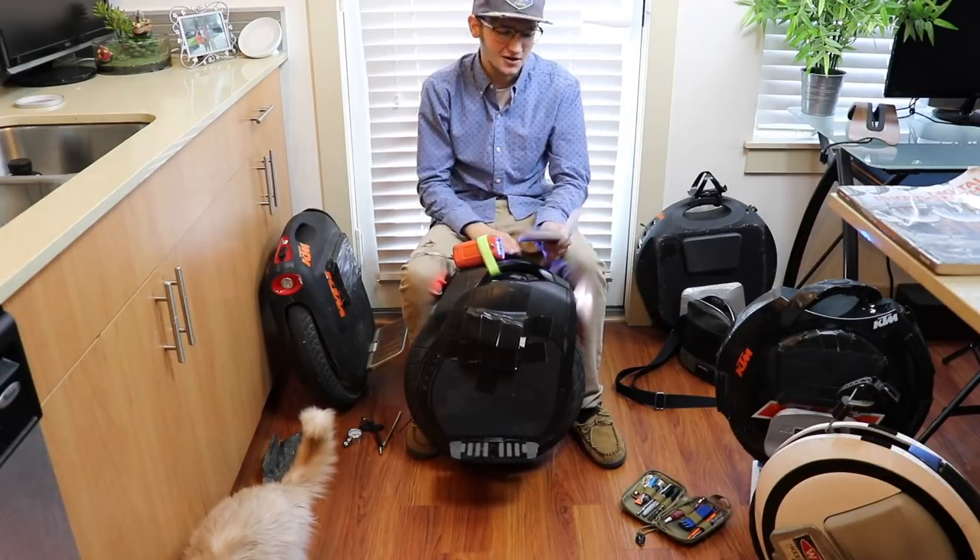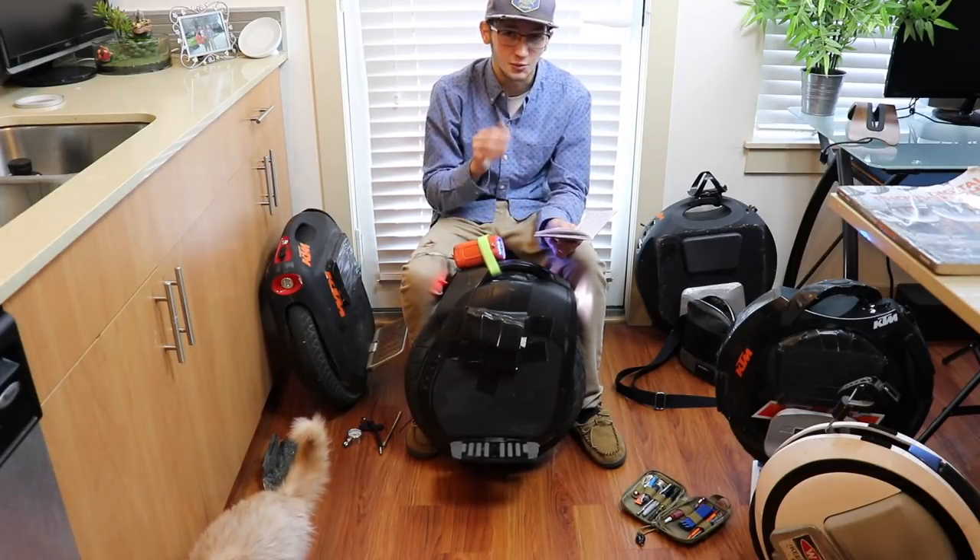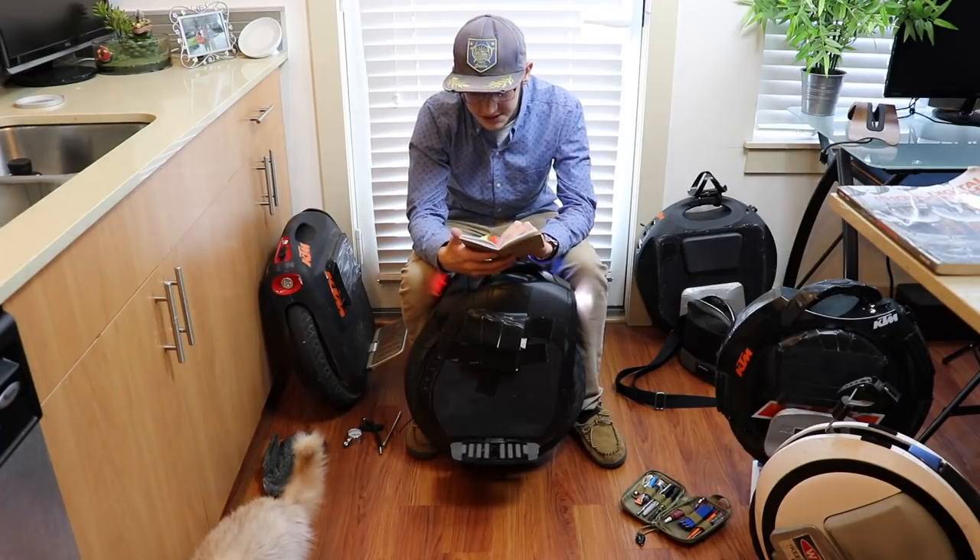It was going to be like a 50 to 55 mile trip — from downtown Denver all the way to Cherry Creek State Park, hitting off-road trails. That's what killed my battery — all the off-road trails and stuff you saw me hitting in those videos were offshoots of my range test. All the off-roading, high torque jumps, decelerating and accelerating eats your battery. It says 52 miles, but if you're doing hard accelerating with low tire pressure, expect around 45 miles — and the last two or three miles will be really slow.